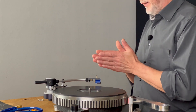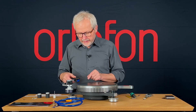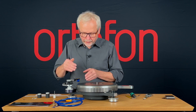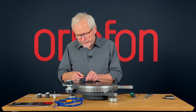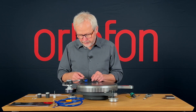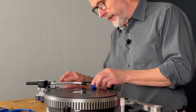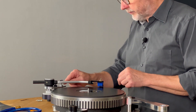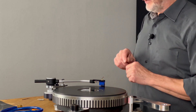The next thing is the swing angle. I have the tone arm in the tone arm rest here. We must make sure that when I want to lower the cartridge down onto a record, I am free from this tone arm rest, because otherwise I will be touching it when lowering down. This is just on the edge — I'm still touching the arm rest here, and I am approximately where the record would start.